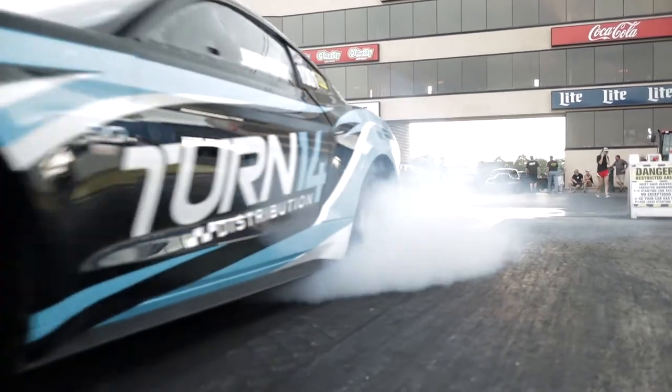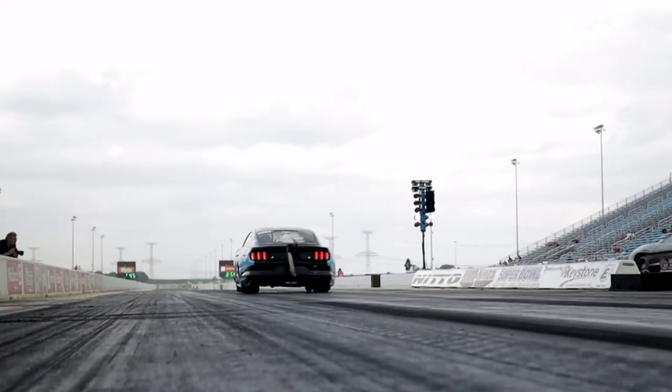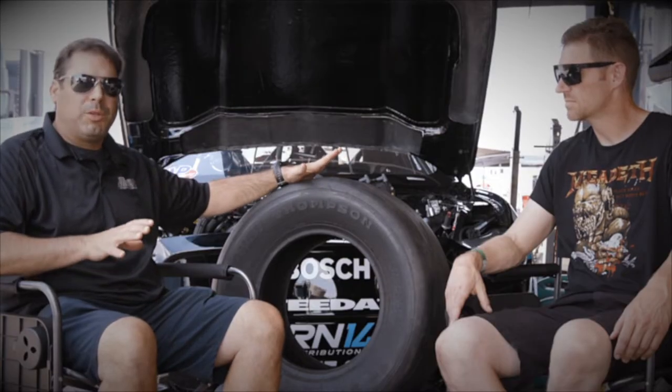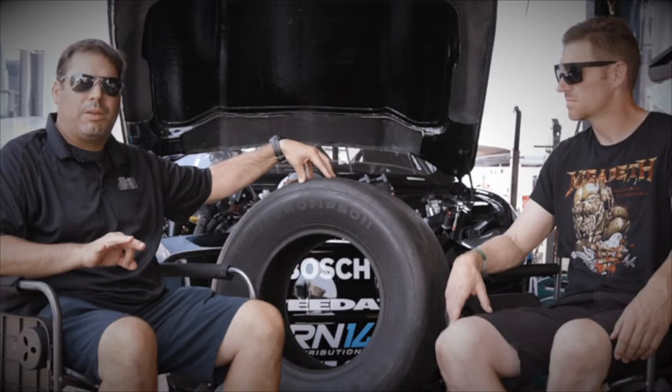John's been racing since the beginning of NMRA in 1999 and through the years he's had a couple different tires as the technology's changed quite a bit. We've gone from a 28-10-5 slick to 275-60 R15 drag radials. Mickey Thompson has produced this thing in a couple different formats and the latest baddest version is their Pro 275, but they've got three levels of it.